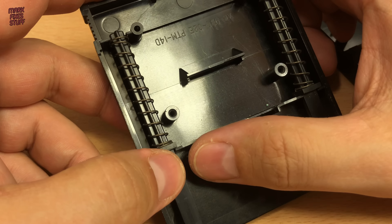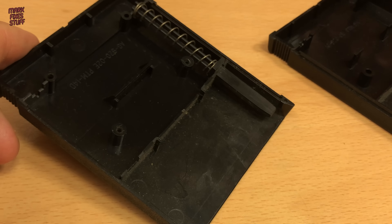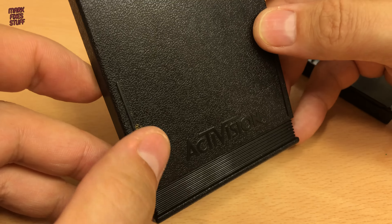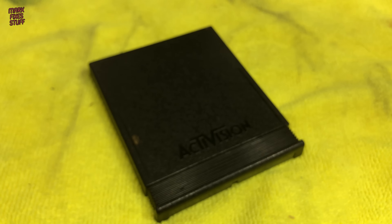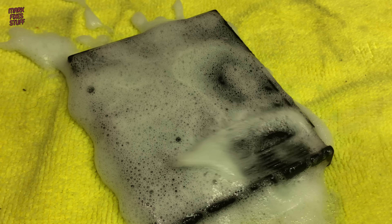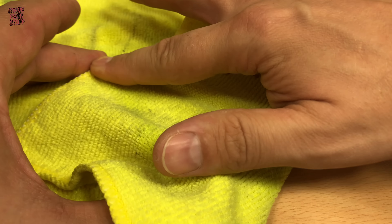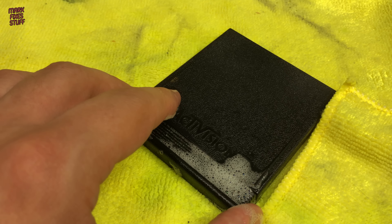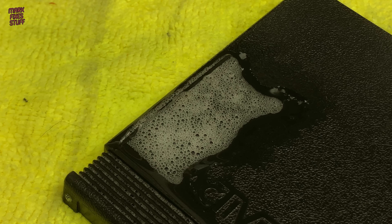Turning our attention to the case, we need to carefully remove these spring-loaded inserts. For cleaning plastics, I recommend a cheap window cleaning solution. It really dissolves dirt and is much more effective than IPA on grime. Sometimes a stubborn patch of dirt might need an extra soaking. Aqueous-based cleaners are more useful on non-greasy grit, grot and grime, but you do have to have some patience.